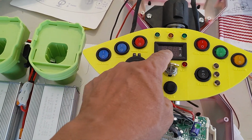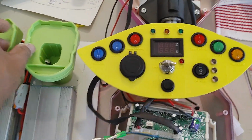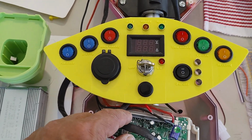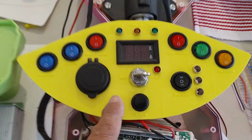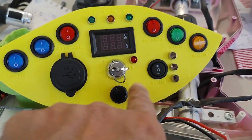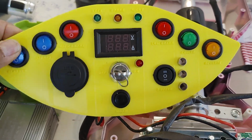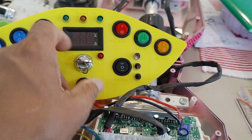This doesn't matter, because this connects directly to the battery, and it will be reading 42 volts, because that's what you want. You want to read the full voltage of the battery, and this will probably have an alarm. It's something that I don't show here. When the voltage drops below a certain level, it'll either shut off or give me a warning. I can put a little low battery flash alarm here, or use one of these LEDs for double purpose, making it flash with additional electronic circuitry, to let you know it's time to shut it off and recharge.